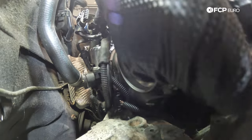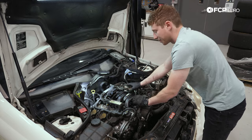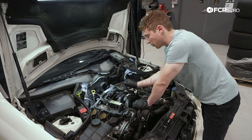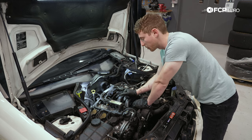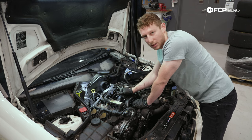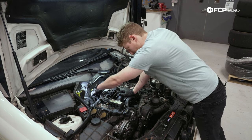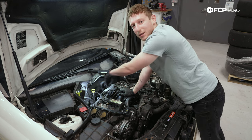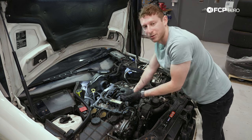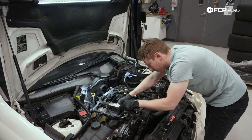I kind of have the wiring harness on the passenger side loosely mocked up with where everything is supposed to be. If you are doing the M014 manifold swap, you will have a loose sensor at the rear of the engine. That is because we have deleted the intake flaps, so we are omitting that rear flap sensor — the one that was formerly transverse mounted at the back of the manifold. So you will have a loose connector. Otherwise, you're going to have the standard number of fuel injectors and everything else. Let me go ahead and start plugging in our fuel injectors, starting at the front.